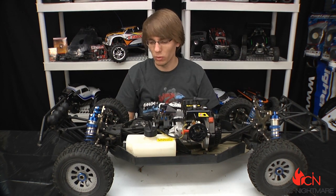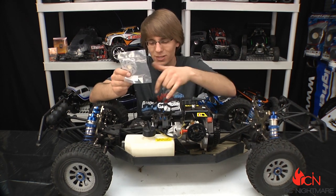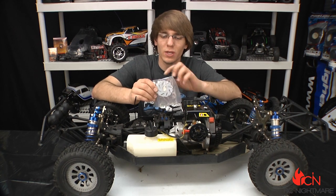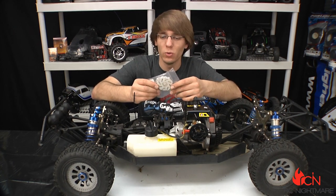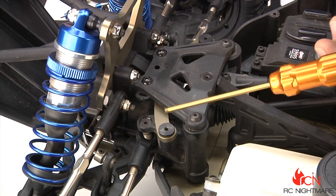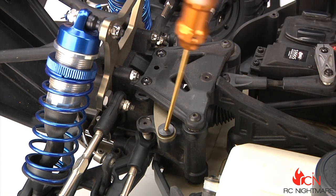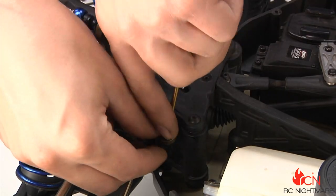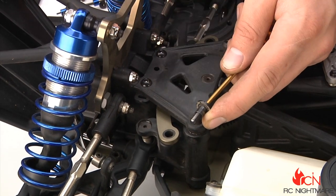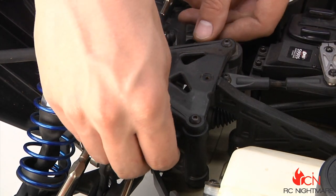So we're gonna install that for you. Now, here we have the drag link and the two shoulder screws that hold it on — we just want to remove these first. I have my shoulder screws out. You can see it's just a steel screw with a metal bushing in there. You can also see how short the threads are. The drag link simply pulls out the side.